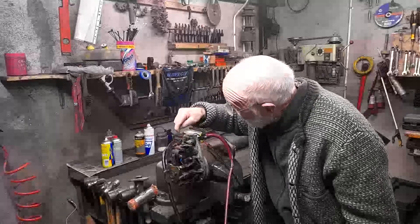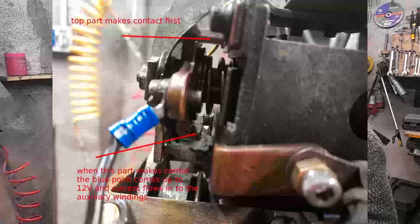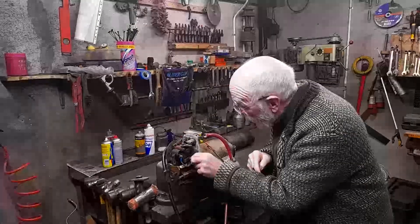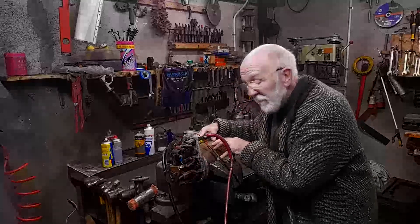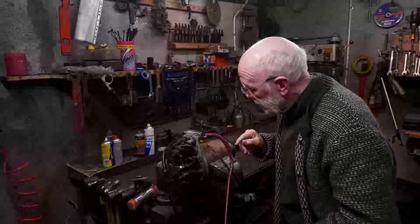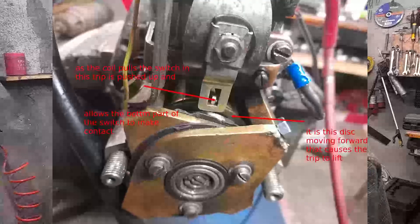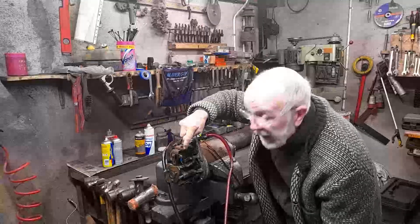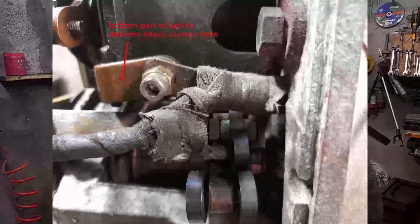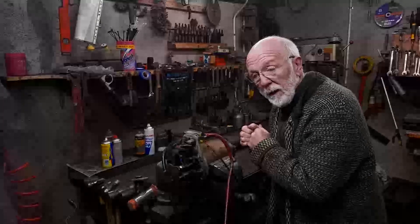This switch is designed in such a way that the top part makes contact before the bottom part. Whenever the top part makes contact, it brings this point up to 12 volts. Current will then flow down through that thin wire into the windings inside, which causes the whole rotor to come out and rotate slowly. But as it comes out, it causes a little mechanical trip in here to rise. And that means that the bottom part of the switch can then make contact, and heavy current can flow down through this insulated wire into the main windings in the starter, and the full torque is applied, and the engine will start.